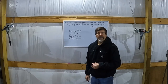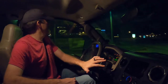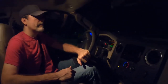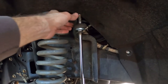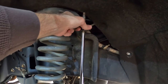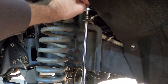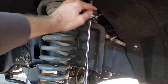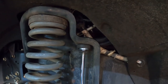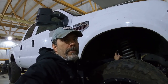First, let's start with the pop that happens at low speed turning. Here's kind of a ghetto experiment to see if this will make the pop noise stop. You can see this bushing was rotting down over this thing right here. I've got a couple of washers stacked on top of that to keep the bushing from going around it, and we're going to see if that takes the slack out and makes it stop popping. Well, installing these spacers to take the slack out of the shocks may have helped the ride a little bit, but it did not get rid of the popping sound.